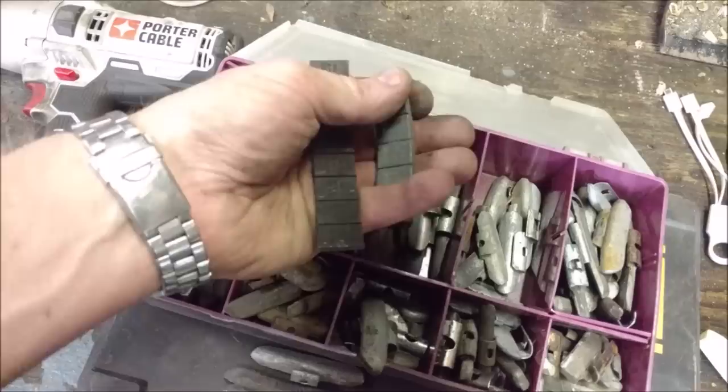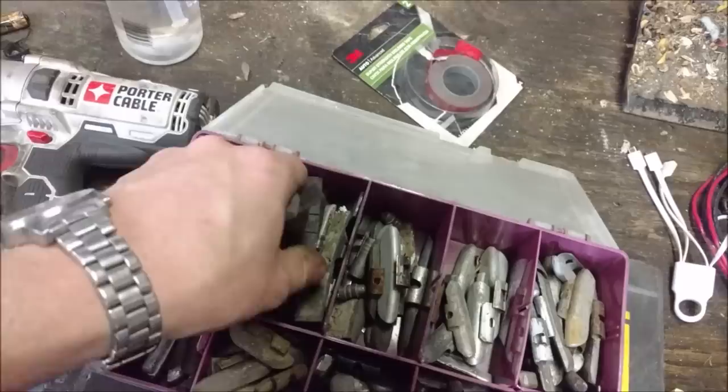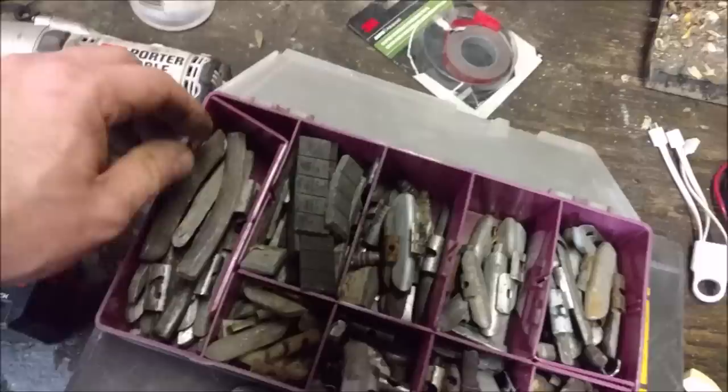Or you have the stick-on ones, and I'll put a link below. You can buy these. These are great for manual balance as well, because I use some double-sided 3M sticky tape, actually molding tape, to attach these type of weights. I actually use these weights quite a bit on aluminum versus doing these, because these just gouge up pretty aluminum rims, and you can put these right in the center when you're manually balancing.